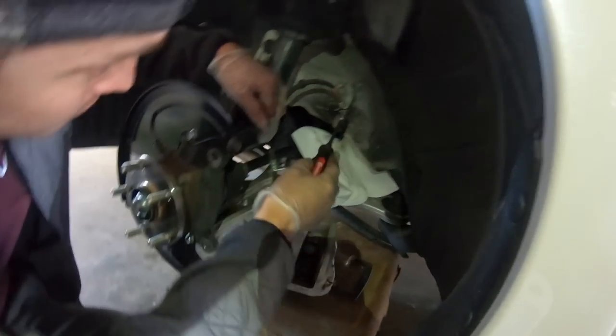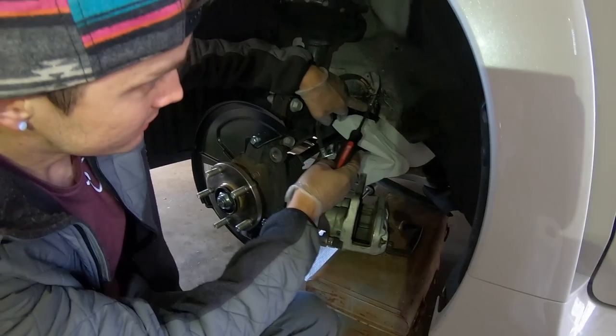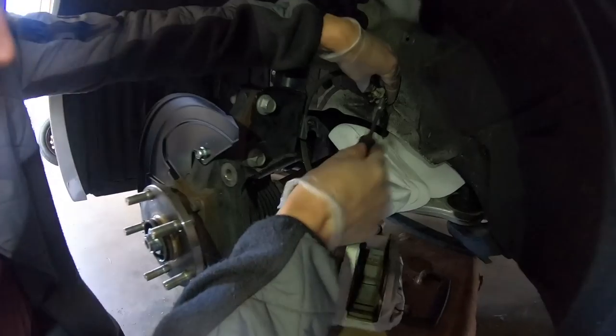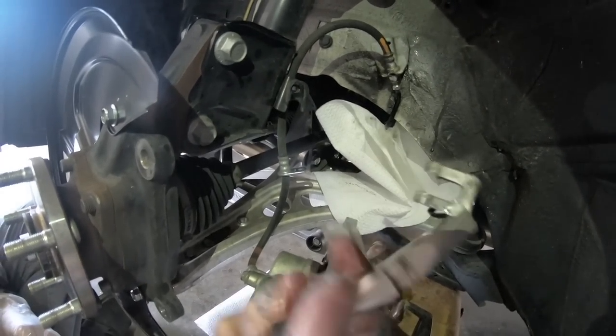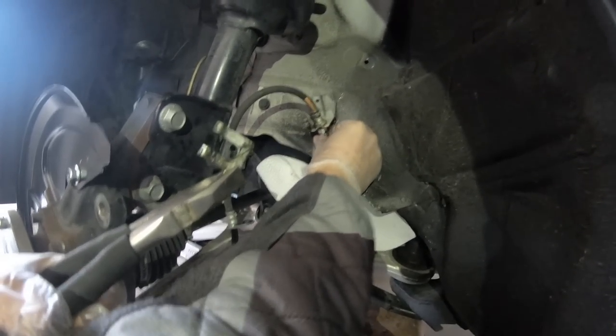Buddy Eddie's adjusting the camera right now. There's a little clip in here - I've got the flare nut at least, but you're going to have to get this clip off. There it is - a bit mangled, not bad. I could probably bend it back, but I bought new clips just in case. That's out. Now I can undo my flare nut and get the stock brake out of here.